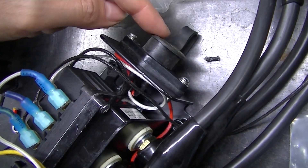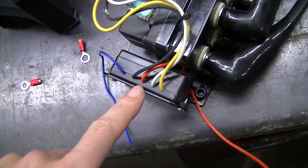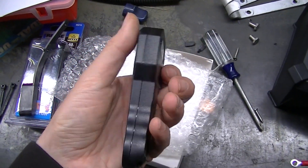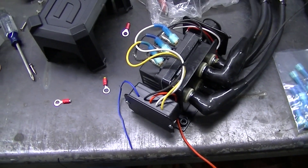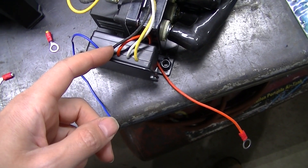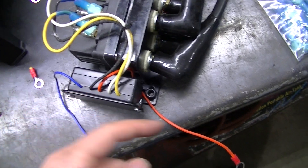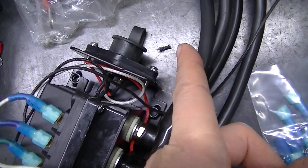The handheld controller plugs in here. I've added something to this — I've added this little black box, and this is a wireless winch kit. With the kit you get this little box and you get this remote. I will link this in the description and the comment section so you can pick that up if you want. From what I understand with the directions, there's four wires coming out of here. The black is the ground, so I've got that run to the terminal that is being grounded, and then the positive is going to go to the positive cable on here, which is the same thing that's happening over here with this handheld controller plug.